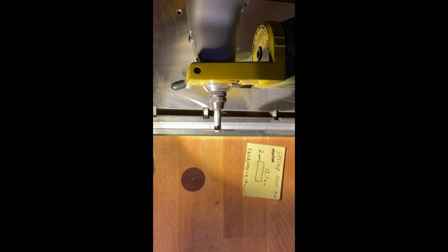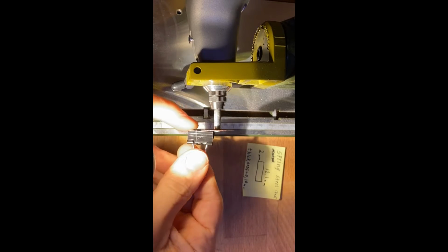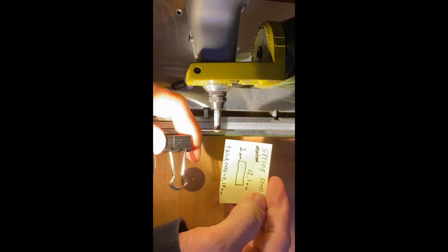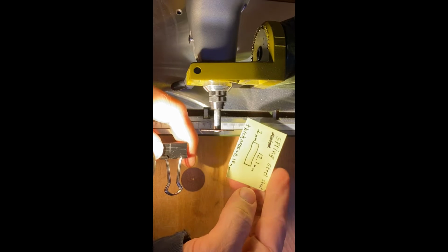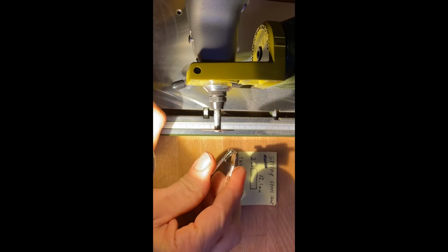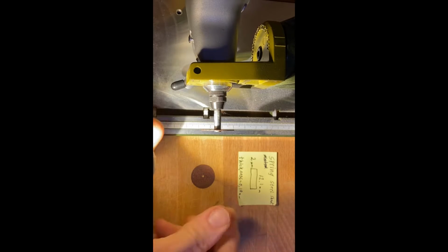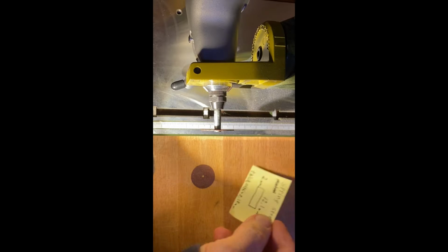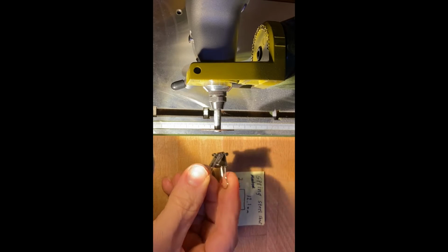So now I will cut the little clamp here, and simply cut it to the tiny piece that should be, as you can see, 2 millimeter width and something like 12.1 millimeter, and the thickness of this clamp is actually very thin steel. The old one was something like 0.10 millimeter, and this is actually the same, the thickness of the spring metal.